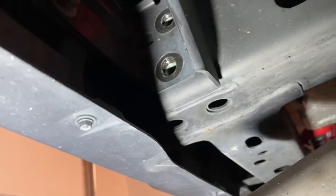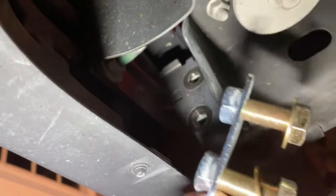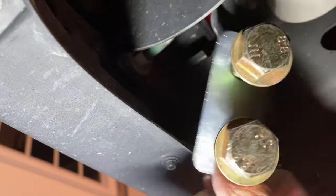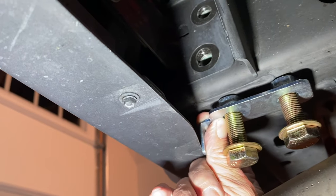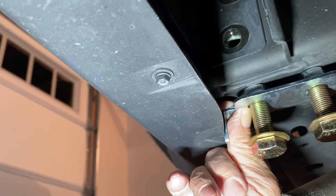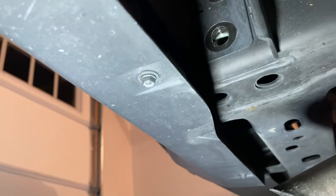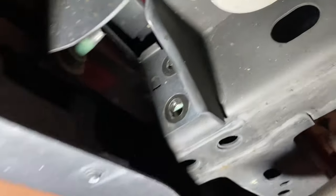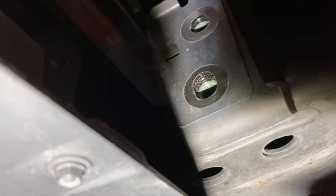Maximus 3 did include two bolts. You will slide this up inside the frame and those bolts will drive up into there. All the bolts are torqued to 94 foot-pounds. I'm going to use some blue Loctite just to have that extra assurance — it does look like they had some form of Loctite in the factory holes. I'd also like to make sure that I can remove the parts later in case there is some corrosion, and that will help.